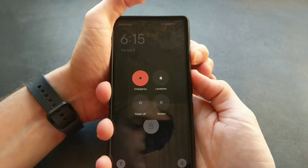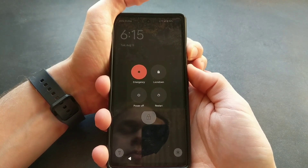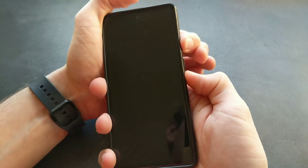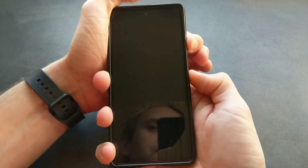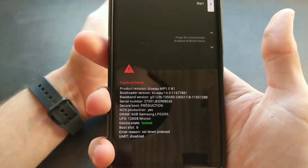So I'm holding this — it will take maybe 10 seconds, so keep holding till it restarts. You're doing a force restart basically at the moment. Then hold the volume down button and the power button, and keep holding it. Even if it's blank, keep holding it, and we got into this fastboot mode.